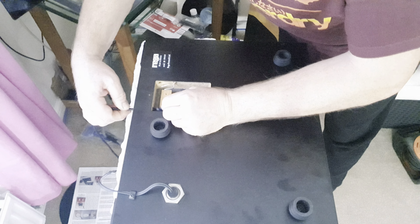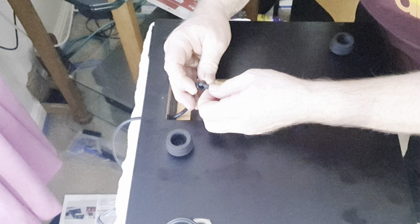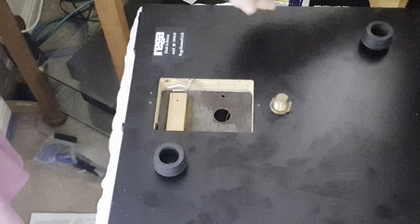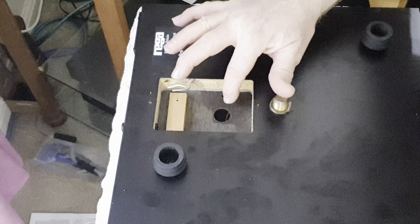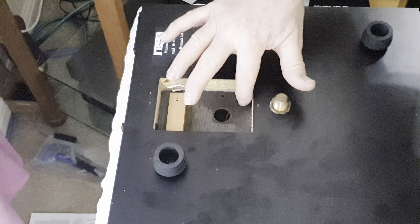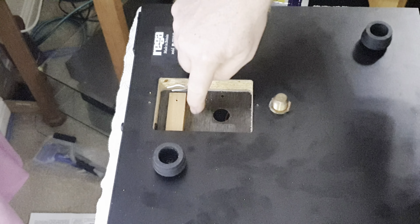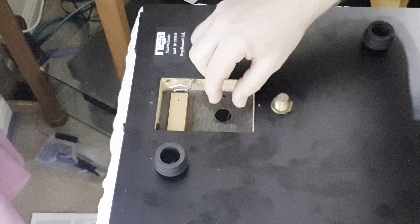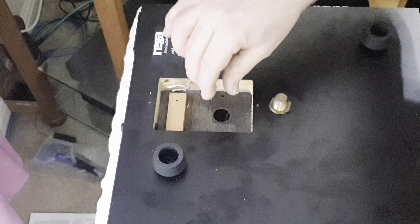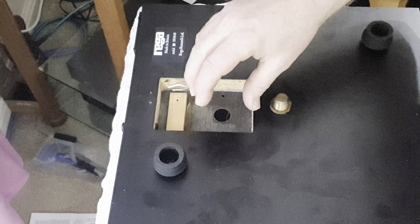If you pull the original power cable into the space a little, you'll see it's got a knot to prevent it being pulled out. Undo that knot and you can pull the power lead all the way out. Depending on the vintage of your model, you may have a cutout cut all the way through the plinth substrate with only laminate on the top surface, or it may be cut only partway through, giving a bit more substrate strength. After this point, be very careful when installing the motor not to push hard on the laminate because you could easily break it.